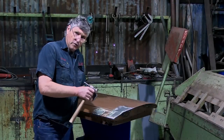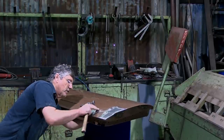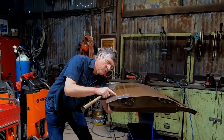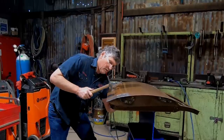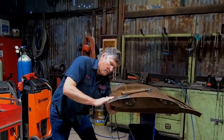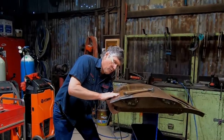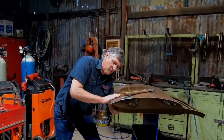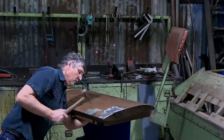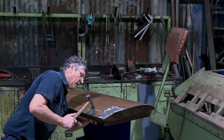I'm going to use the straight edge along the edge of this heel dolly and get it just under the line, supporting this line along there. That's bringing that patch down in line with the metal either side of it, but we're increasing this area in here where it's actually pulling it and straightening out this little reverse curve. So if we get into the reverse curve — we know that's along here — we can tidy that up with this edge of the hammer.